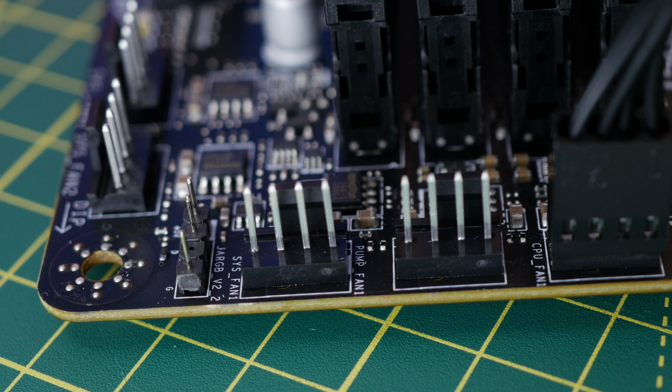So this makes life a lot easier. It keeps the cables away from the front, and it also makes powering the fans much more simple than having to worry about motherboard connections. Then you plug in the RGB connectors from each of the fans, and again you can have up to 6 fans on here, and that's the most straightforward solution. This in turn needs SATA power and again a USB connection to your motherboard.